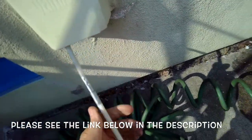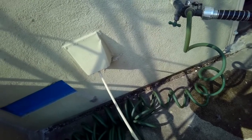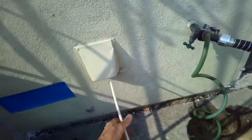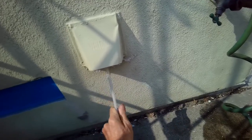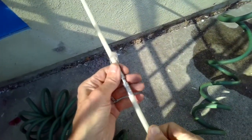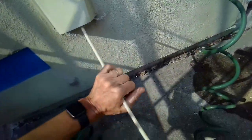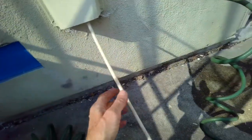I don't think it's very far of a run — maybe 12 feet. I can feel a little resistance. This thing breaks up the lint but also pulls out any accumulated lint. We're already about six feet in — we'll add another three-foot section. When you buy these kits, they give you 12 feet, which is usually enough for most places. Each section is three feet. Put it in your drill, tighten it, and make sure it goes to the right — clockwise — otherwise the ends can undo inside the vent tube, which you don't want. As long as it turns that way, you're okay.